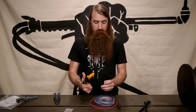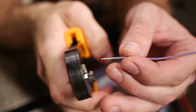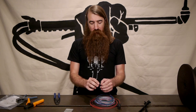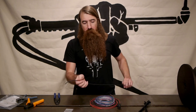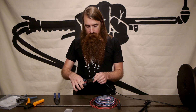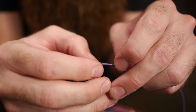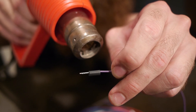I'm going to use a different type of crimper — again these tools are available on our website. This crimper is going to create a square on this ferrule and that's going to secure it to the wire. Just squeeze down until it releases the ratchet and now we've got a great connection — this is an excellent electrical connection. It's got mechanical support, but there's one more thing we can do to make it even more robust: add in a little bit of self-sealing heat shrink. We can create a seal so that we don't have any corrosion or oxidation and we can also provide additional mechanical support so there are fewer issues with fatigue.